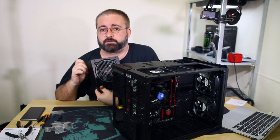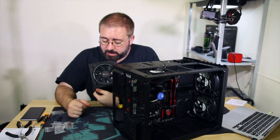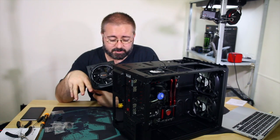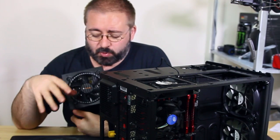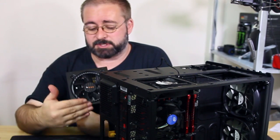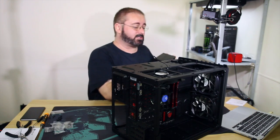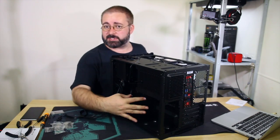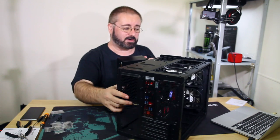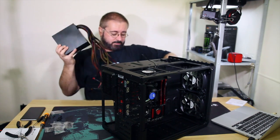Is the position of your fan. Each case will have two options depending on where you want your fan. You might want it exhausting up into the case or down out of the case. This particular case is designed with one mounting position in mind, and that is using the fan on the outside, because there is a vent directly on the side panel here. This case has the power supply in its own separate chamber, so we don't need to worry about its exhaust affecting the cooling temperature of the rest of the case where the CPU and graphics cards should be.